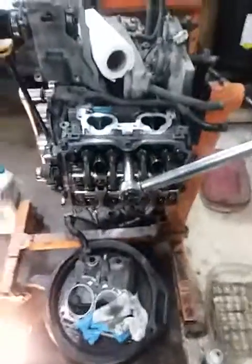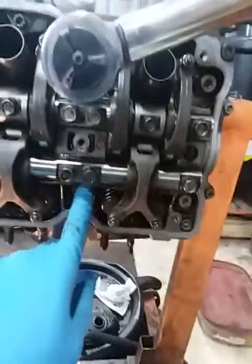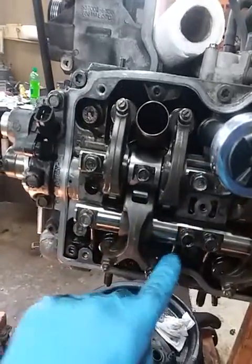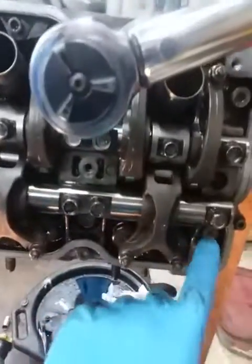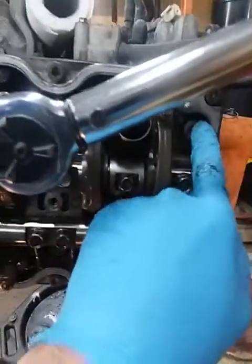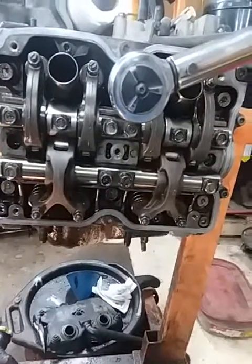Okay, now we're going to torque this thing down. Alright, we're going to start here, there, crisscross pattern. Okay, from here to here to here to here, over to here, and up to here. Okay, now what I'm going to start is I snugged it down. It's probably like about 10 to 15 pounds or something. Just snugged it by hand.